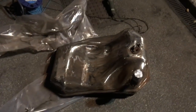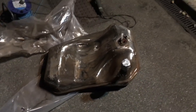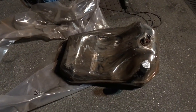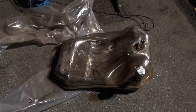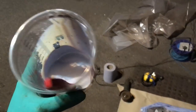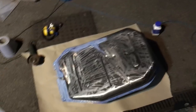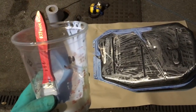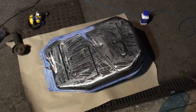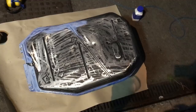I do have the deox gel as well, but that always means washing it off with water which seems a bit counterproductive. So I'm just going to put loads of this on, particularly at the seams, and then tomorrow it should be right for epoxy. I've decanted my Hydrate 80 into a mug or cup thing because it's oxygen sensitive - if you leave it out for a while it just screws up what's left in the bottle. That's the tank upside down and I'm just painting the rusty bits because this stuff's quite expensive.